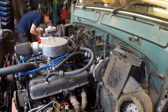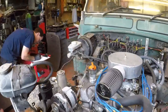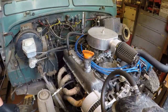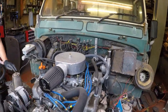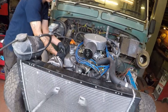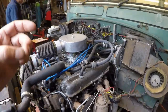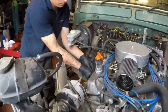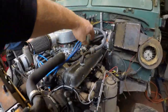That's basically how you do a compression test. If we notice one gauge goes up to 150 really fast, we know two cylinders are creating compression at once, so we'd suspect a blown head gasket between the bores. You won't notice this with water or oil mixture because there's a very small piece of metal between the bores of the head gasket that can blow through.